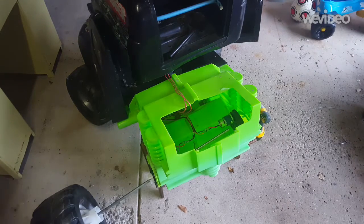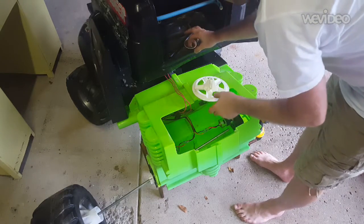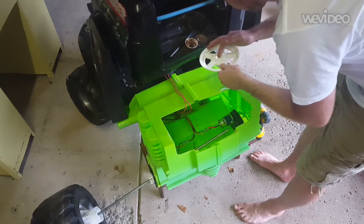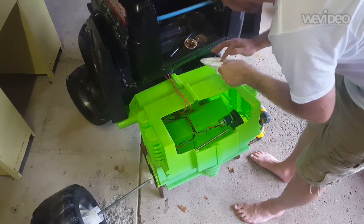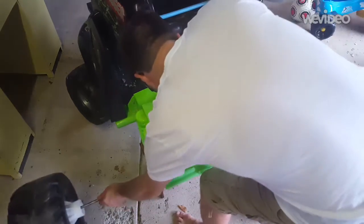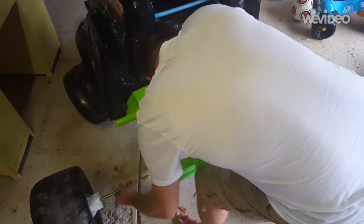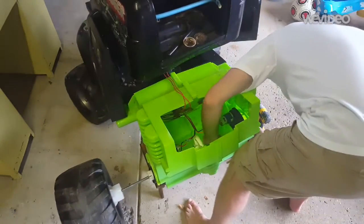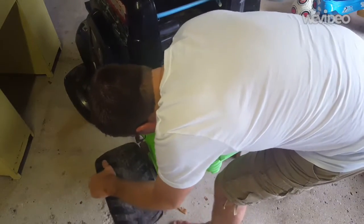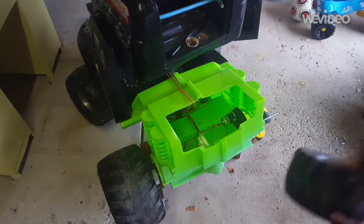And I'm going to put a little bit of gear grease in there, probably unnecessary here. I did notice when I took it apart that it was moving pretty hard, and anytime you can free up friction on these things, it's less likely to strip or blow out a gear, and I've done my fair share of them for sure, so I'm trying to be as preventive as possible. Oh yeah, that slides in much better. Straight through the gear and out the other side. And these are going to mesh with the gears and the motors, and we're looking to be in pretty good shape. Good job, dude.